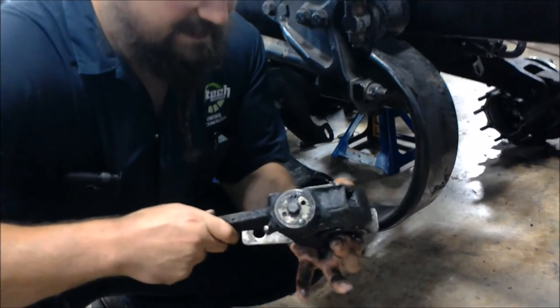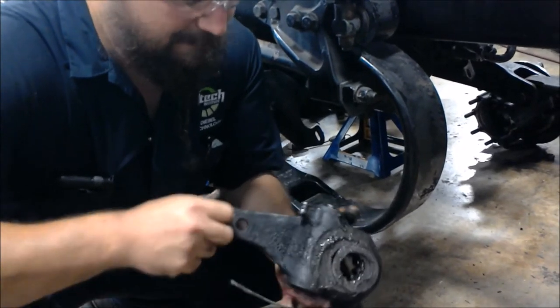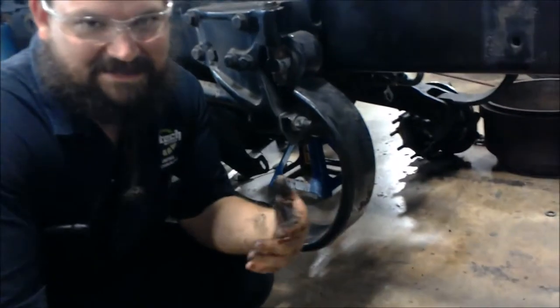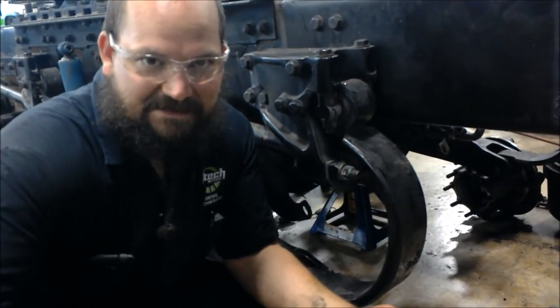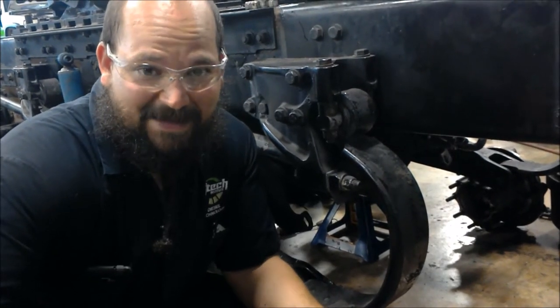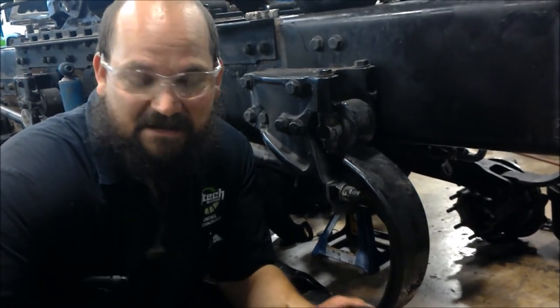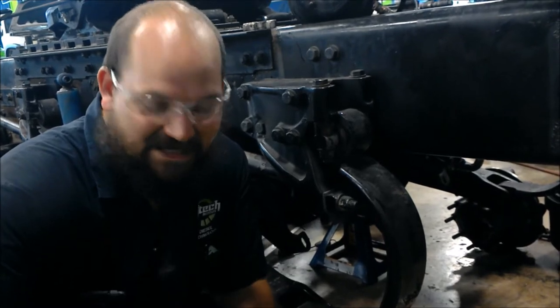If you're looking for any excessive wear, cracks, broken pieces, or bent components — making sure that it has been properly serviced at intervals, usually only when the lining's been replaced — then you should double-check the stroke length and automatic slack adjuster. Other than that, it's just regular servicing: greasing the pivot points, making sure the grease comes out where it's supposed to.